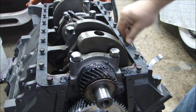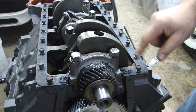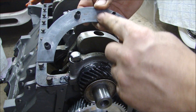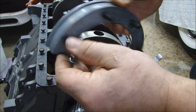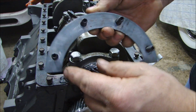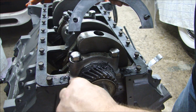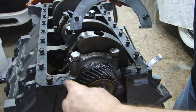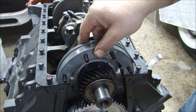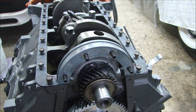Now I have my gasket on and I have all my oil pan screws in all the way around just to hold the gasket in place so it doesn't move away from the holes. I'm going to put this half moon piece on. Rather than have bolts in here where you usually have bolts, these are studs. These studs are put in here because these sometimes strip out - if you have bolts in there, those might strip out. So you can take those out and put studs in instead, which makes it a lot easier for assembly. I have some Right Stuff on my oil pan gasket and I'm just going to sit this in place, kind of push it down and mush that stuff out a little bit, kind of get it centered.